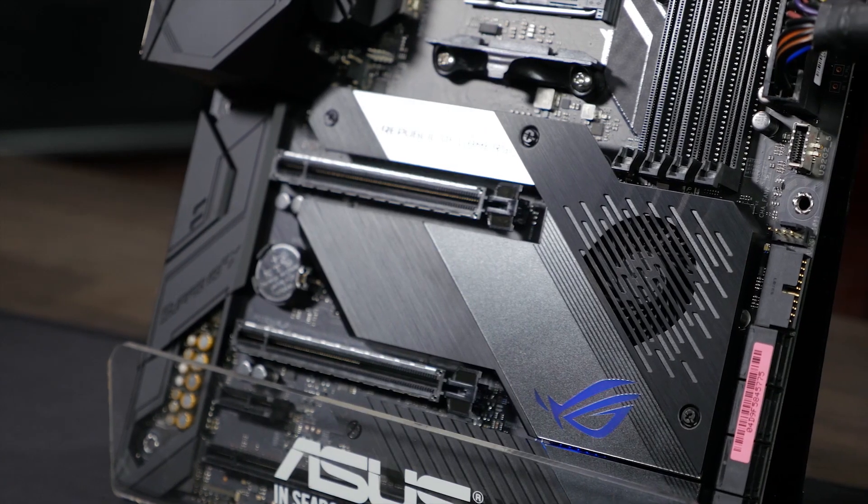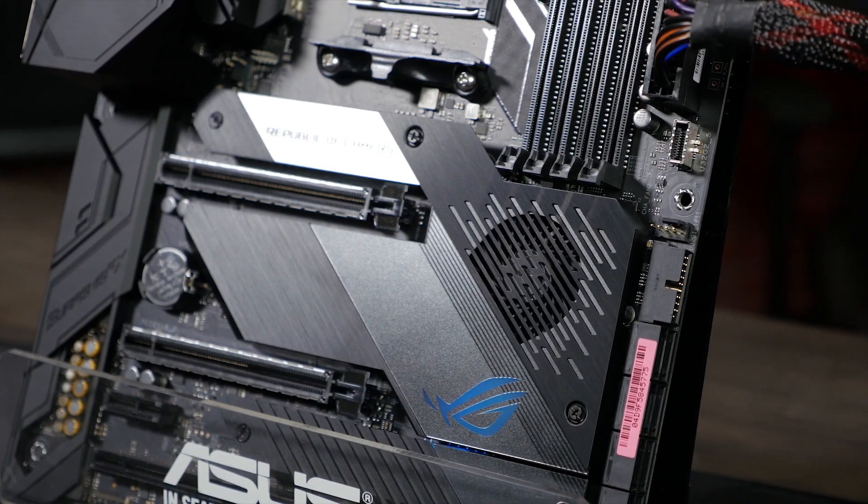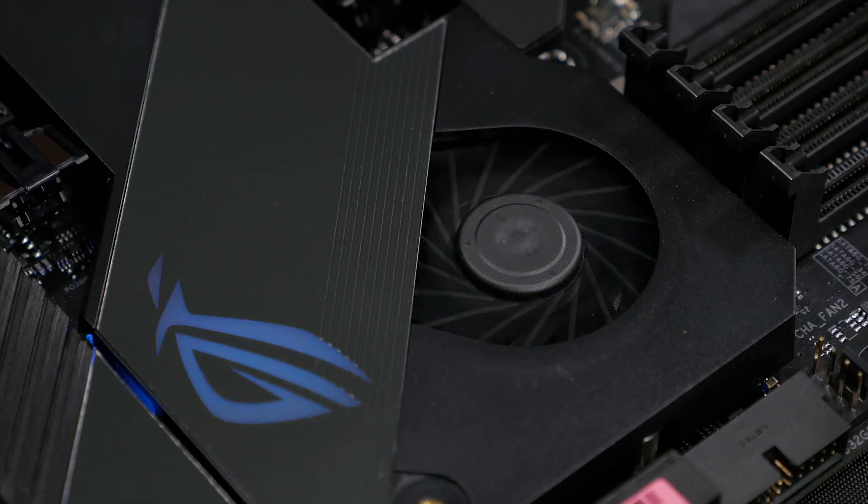With the increased power of the new Ryzen CPUs, there also comes a rise in heat. So to combat this, the Hero has plenty of built-in cooling features. We collaborated with Delta to create a custom Superflow chipset fan with a 60,000-plus hour lifespan. It has specially designed air ducts to help the fan generate more static pressure and focus air over the heatsink.